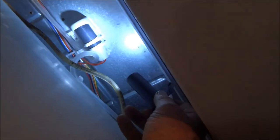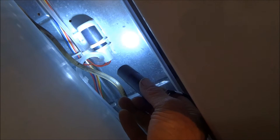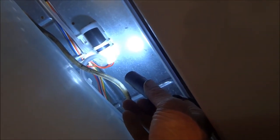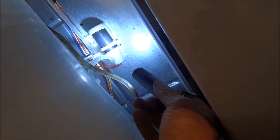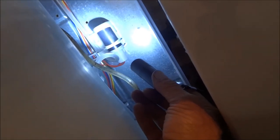Be very careful because these wires on these capacitors can get corroded and be loose. Don't mess around with it too much. But if you do get a hum, you might want to check this out. I just simply pushed the wires back in a little bit and it worked — it didn't seem to be a problem. But I have seen these capacitors give a similar symptom.